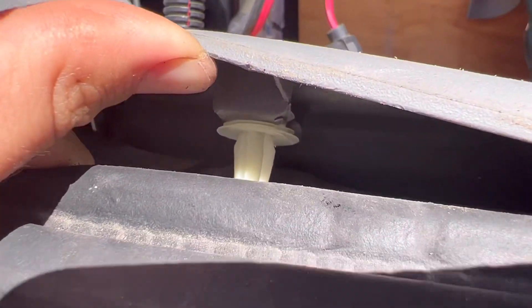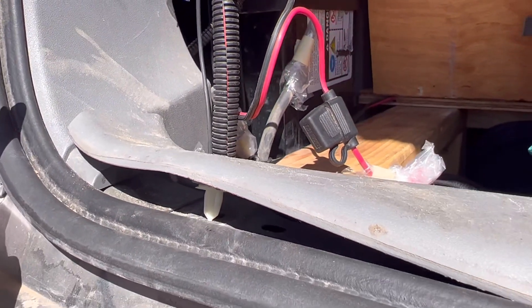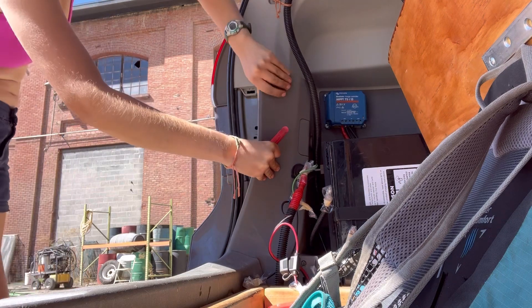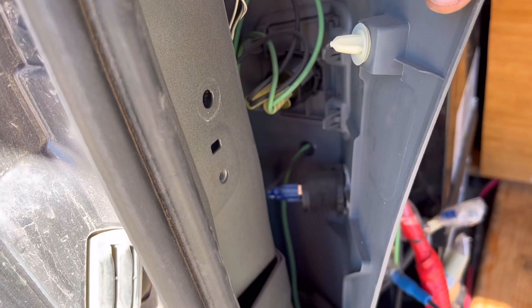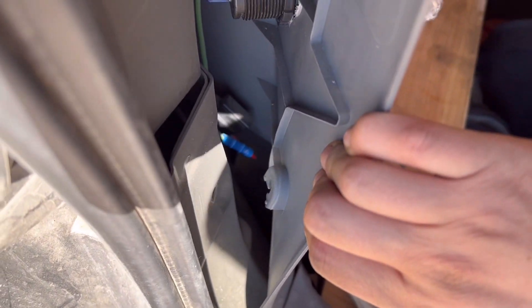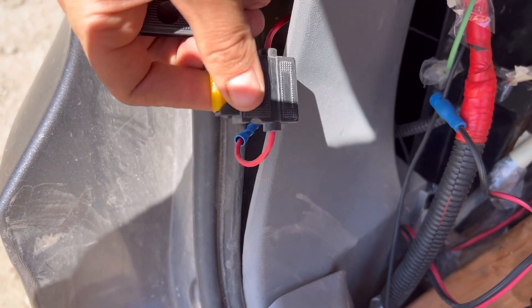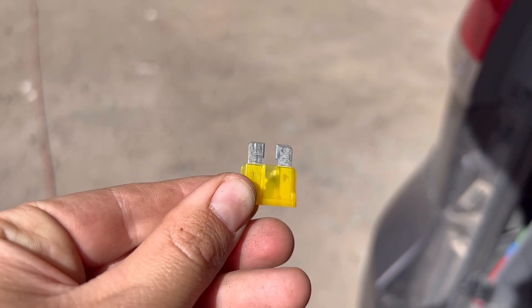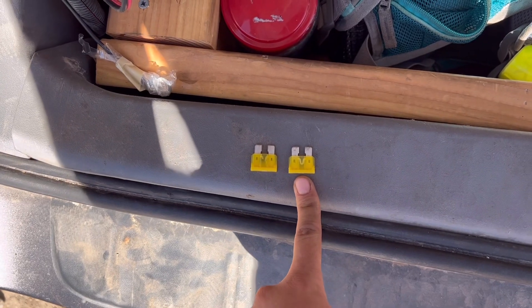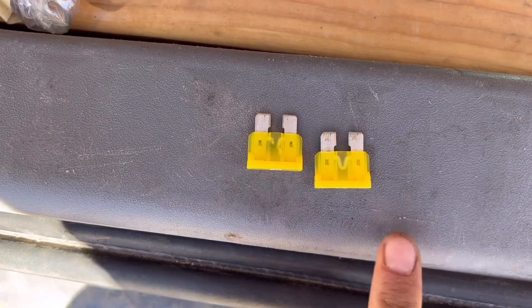This is how it looks on the other side — kind of different, kind of weird, but that's okay. I don't need to know everything about why it's like that. We have success! It's so cool to see this from the inside. Now that I have access to this, the first thing I'm going to do is check this fuse. I believe this is the problem. I looked up pictures of what good fuses look like — they're supposed to have a U-shaped thing in the middle. This is a good fuse I got from another part of my system. That's a bad fuse. I called my friend that's helping me with this and he said yes, that probably is a problem. So now I'm going to buy a fuse, which apparently you can pick up at most gas stations.